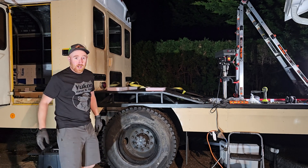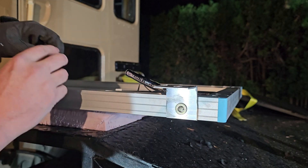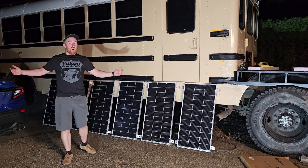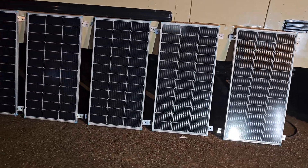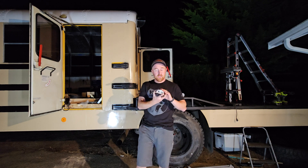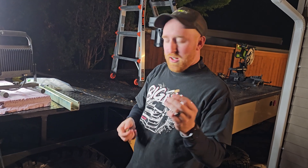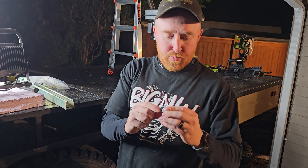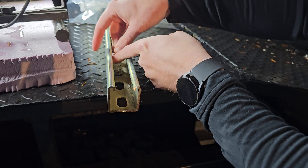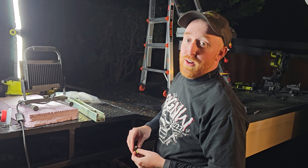With all the brackets cut and drilled, it is time to start working on the solar panels. With the holes all marked up, it's pretty easy to throw some fasteners through, with a washer on each side and a nut on the outside. I now have all six panels with all the brackets on — four brackets per panel. Before we put these solar panels up I'm going to throw up one of those RV things that seals everything so water doesn't leak in. These use spring nuts — put them in sideways, turn them, and they sit in place. That way you can slide things back and forth along the channels as needed to make sure they all fit.